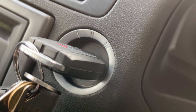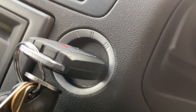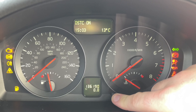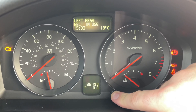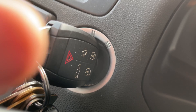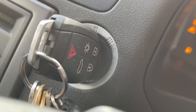With the service done we can now reset the service light. Pop your keys in the ignition, press and hold the trip button, turn the keys to the number two position and keep holding that button until you see the flashing eye symbol in the middle of the display. Then let go of the button and it will reset the service interval. Turn the car off and back on just to check that the message is gone.